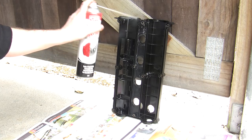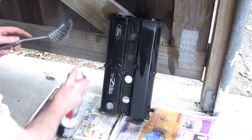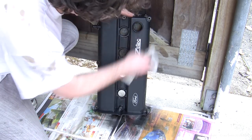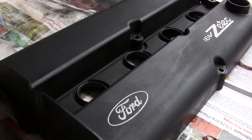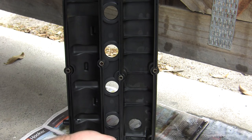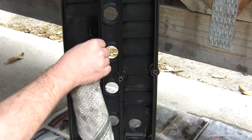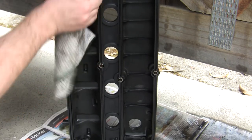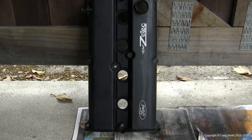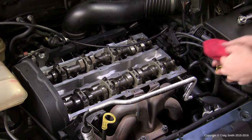Then comes the slightly boring but important job of cleaning the cover channel properly so it's ready to accept the new gasket. Use a rag with plenty of brake clean — you can spray it liberally. It's also a good opportunity to clean the top side of the cover. There will still be stuck bits of gasket in the channel that require manual attention with a tool such as an earbud or rag, going around methodically all the way to ensure no location is left where the new gasket could fail. Leave it to air dry, then do another pass on the engine head to make sure that's clean too.